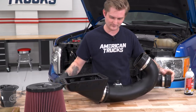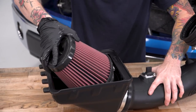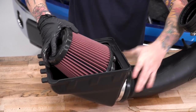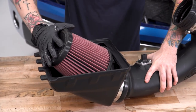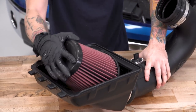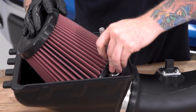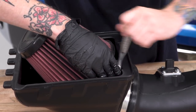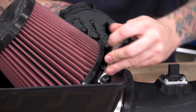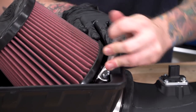We're almost ready to throw the new intake into the truck. Before that, we want the star of the show — the new conical filter. Make sure the large band clamp is on there, throw it onto the intake tube inside the box, and make sure it's seated nice and flush because it's a tight fit inside the truck. Once seated, tighten down that clamp using your 8-millimeter socket. If you're using power tools like a cordless impact, an impact swivel socket is very helpful here.